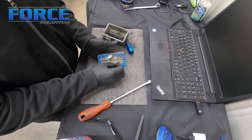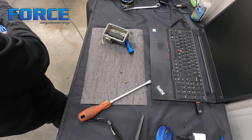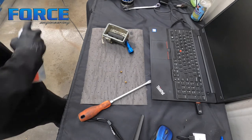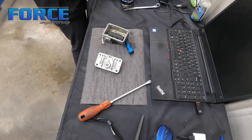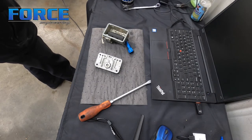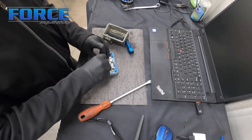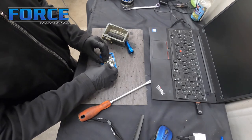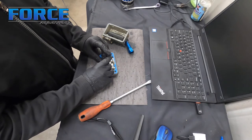I'm going to blast this off with some carburetor cleaner real quick so I don't get stuff everywhere — it's pretty dirty. So the 72s are going back in my jet box. Let me confirm — yep, a couple of 70s. Let's get these in here, then we're going to stick the front bowl back on, pull the back bowl off and do the same thing — go down two jet sizes there as well. Then we'll put the car back together, make another hit, and see where we're at.